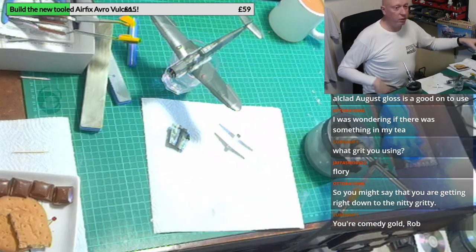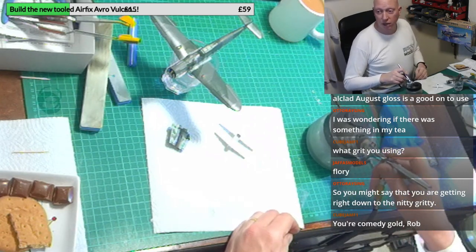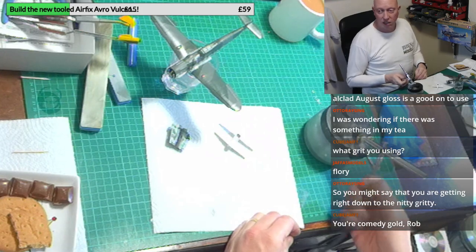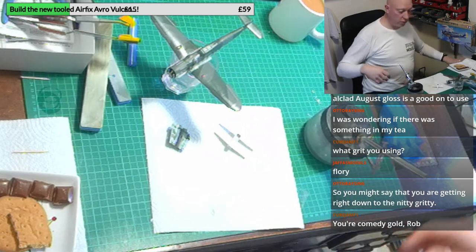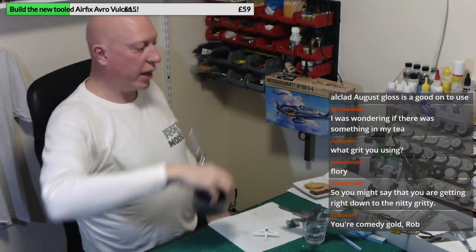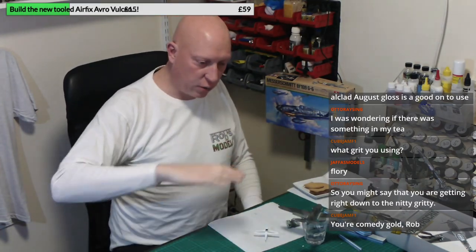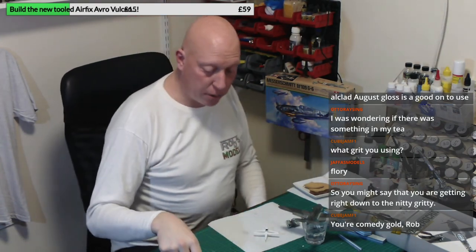Because I know quite a few of you are car guys, building cars. Where you do need to have a really nice silky smooth, really good primer laid down, get all that really rubbed down, then get your main top coat on there, a few coats to really build up the deep color. Then from there you're going to want a really good gloss coat on there, get all that polished up.